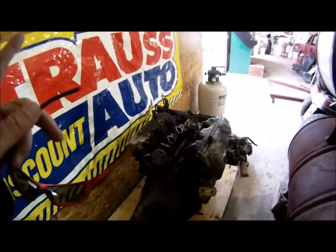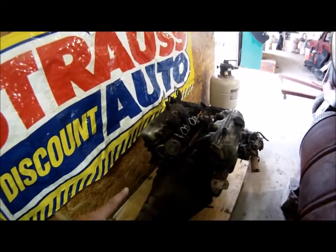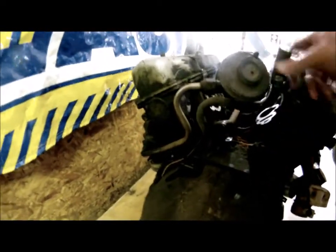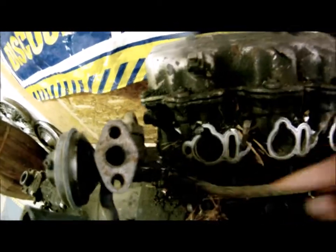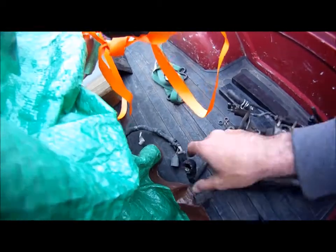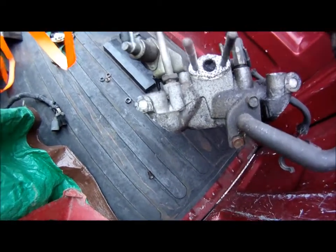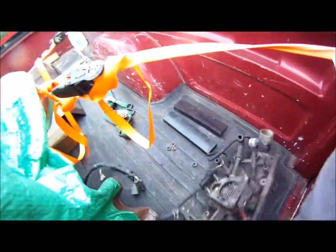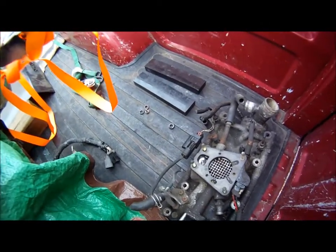The other cool thing is that I've got the truck manifolds, which I can use. There are differences in the coolant pipes that go to the heater core. This pipe coming off of the thermostat housing is different. I'm just going to take the whole thing off and save it. There's also another pipe on the back of the intake manifold that goes to the heater core as well. They're different, but they are bolted on with a gasket, which is cool. So I can take the pipe off the back of this engine off the manifold and put this one on — essentially turning this Z-car engine into a truck engine.